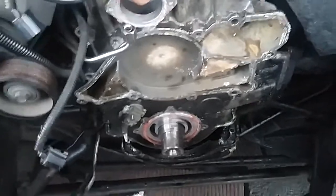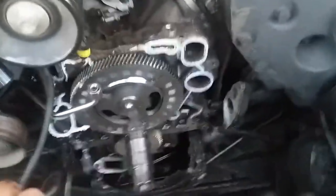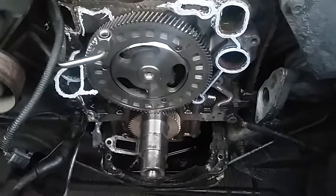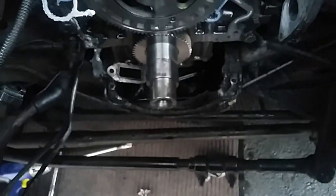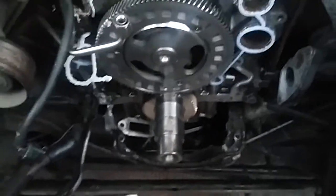Mine is completely out right now, as you guys can see. Here are all the gears, and here's the timing cover — it's already out. It was kind of a pain in the ass but it's done. You have to unbolt the pump and push down the oil pan to get everything free.